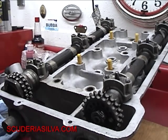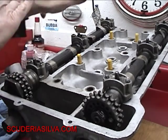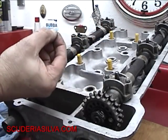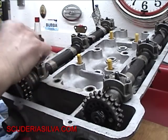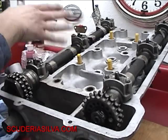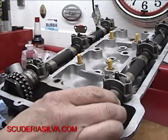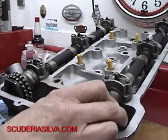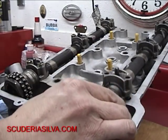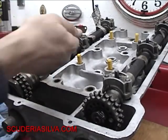Now we're going to do a little math on that. I'm going to strip this camshaft off because there are a couple that are going to need some changes in the thickness of the pucks that sit on top of the valve stems. I'll take this one out, then tighten down the exhaust, which is loose. After we loosen the intake and tighten down the exhaust, we can do that measurement.